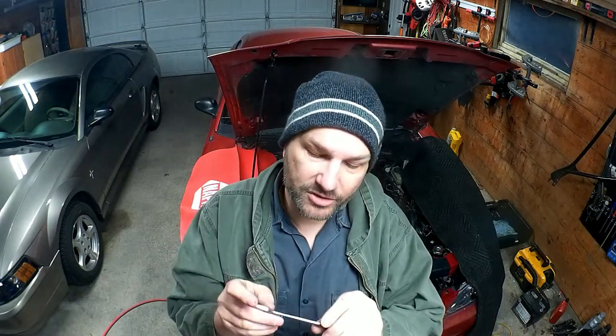That part was pretty easy. Friction disc cut it off. This part, since it's forged, it's a bit hard, and then my dumb ass went in a little bit too dry, got it too hot, and heat treated it. And I'm not a metal guy. I actually wish I knew more about it than I do, but I think that means I made the tool harder there from the heat and pressure, and then made it harder to drill.